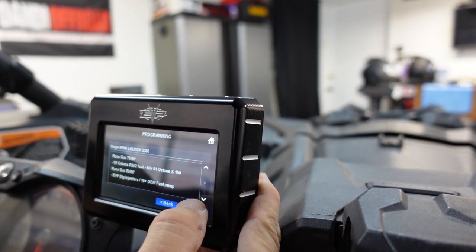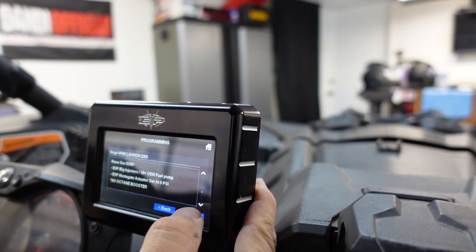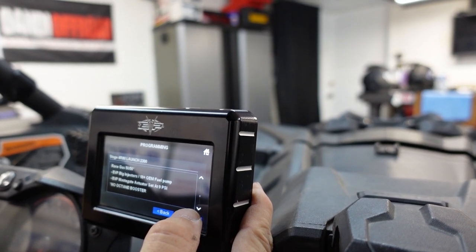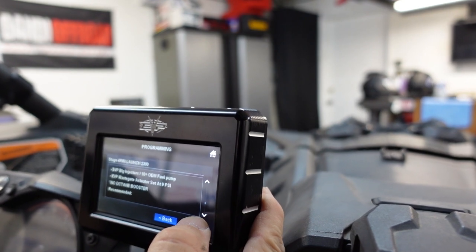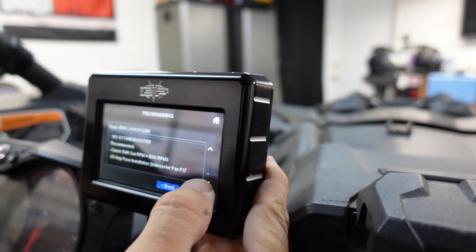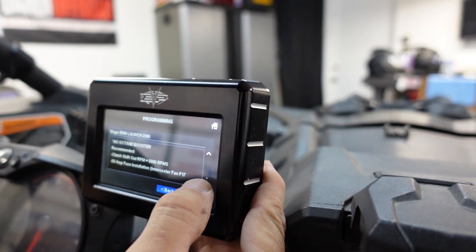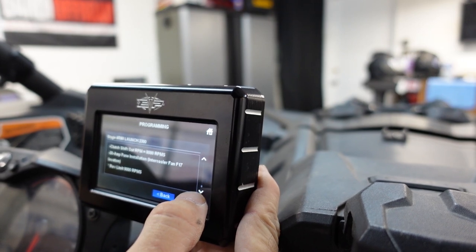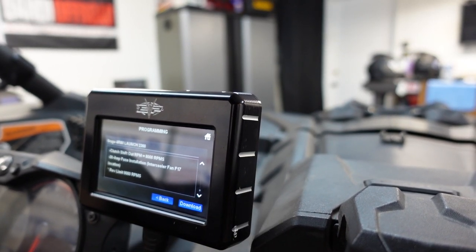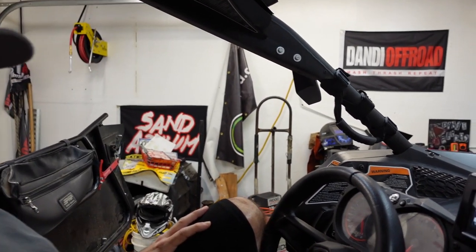Race gas. Evo big injectors, yes. 18 OEM fuel pump bigger. EVP wastegate actuator set at 9 PSI crack pressure, yes. We did that. No octane booster, we don't. Recommended would be clutch shift out RPM at 8,000. 30 amp fuse installation done. And did we do clutch work? We have the Evo clutch, we did the spring and stuff, we got everything, the intercooler fan, the 30 amp fuse, and rev limit 9,000 RPM. All right, let's see what the next one is.